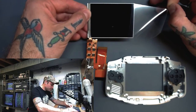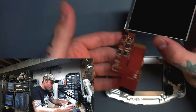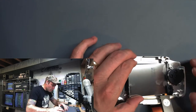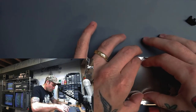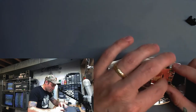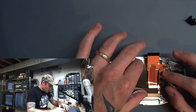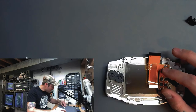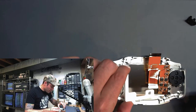Removing our protector. We're going to just flip this over and support that ribbon cable as we do it. It's pretty stiff, so we don't have to worry about that too much. This silicone pad is kind of getting in the way, so we're just going to remove that. And really we want to push this up and to the left and then fold our ribbon cable up — it's going to sit in here something like this eventually. Good thing we have this bracket because as you can see there is a little bit of wiggle room in here, so our next step is to set this bracket in here to really secure everything in place.